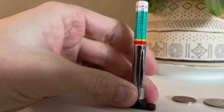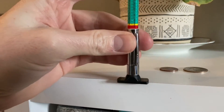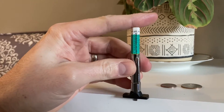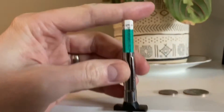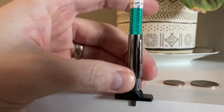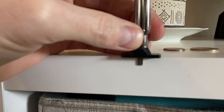As that pin goes into the tire tread, we depress this until the pin stops, and that measures how deep your tire tread is. Pretty simple, right? This is measured in 32nds — 32 equals one inch.